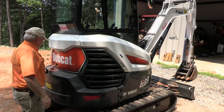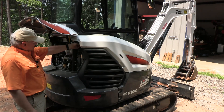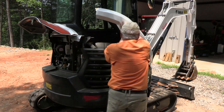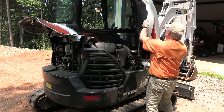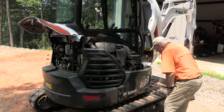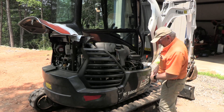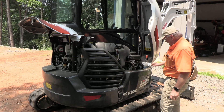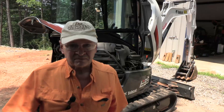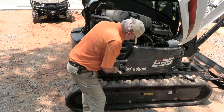Let's open it up so we can find the battery. We'll open up the engine compartment — this latch releases this fiberglass cover, and we got to be careful not to bang the mirror too much. The battery is way down in here. We'll first take this panel off and then probably have to take the windshield wiper reservoir off, but that should be pretty easy.